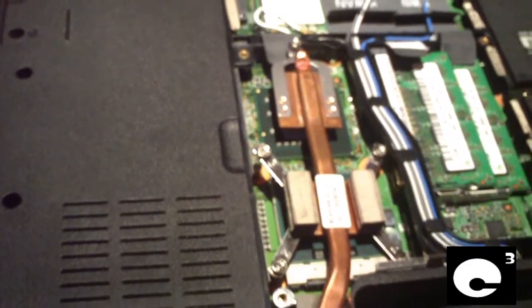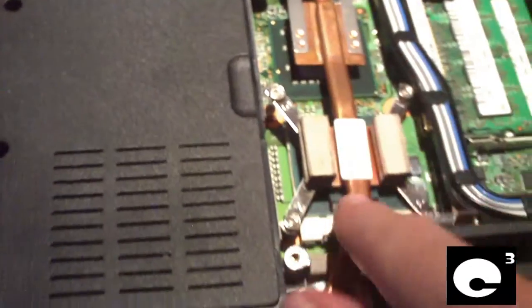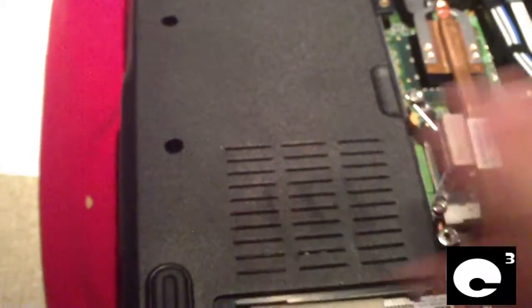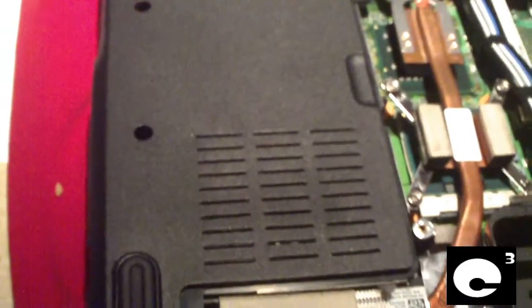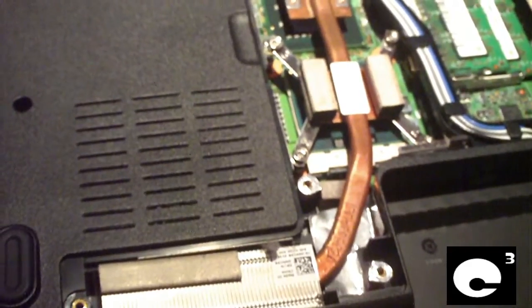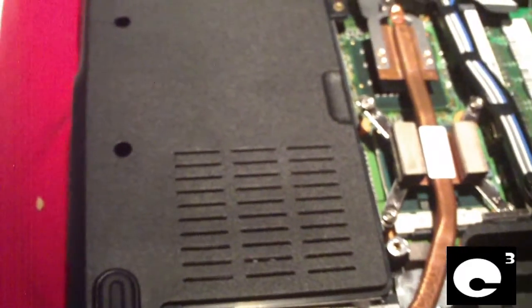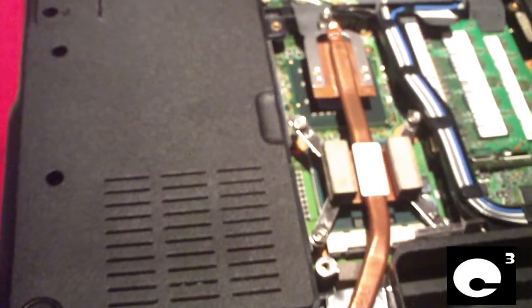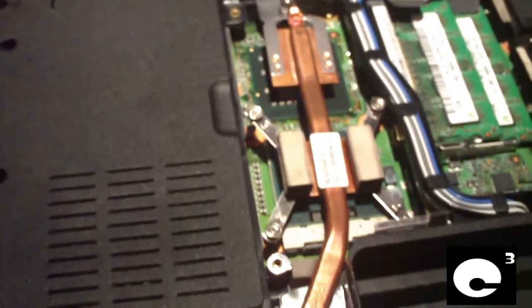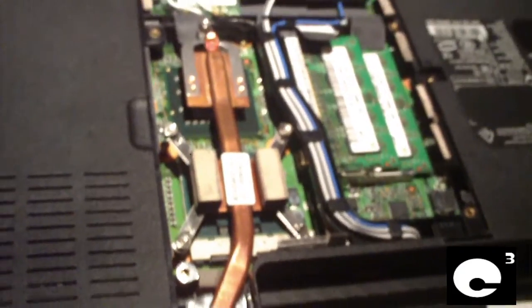Their laptops are very unreliable and their desktops weren't built very well either. More or less, this is a simple overview of how a laptop cooling system works — you have a single heat pipe that runs through the notebook and cools certain components. It's important when running your notebook on a bed to use a book underneath so it can draw air in and won't overheat. When it comes to netbooks, better models like the Acer Aspire One have a cooling plate that goes across the Atom processor and the Northbridge chip. That works fine for a netbook because the Atom CPU doesn't put out as high wattage as a notebook processor. The Atom N270 is rated for 95 degrees C max temperature — very hot, but it's designed to handle that.